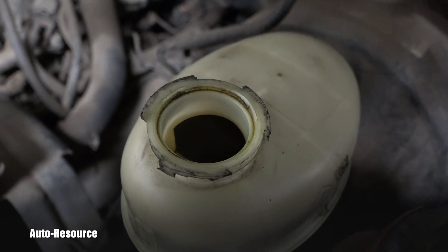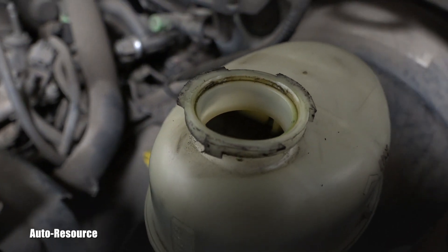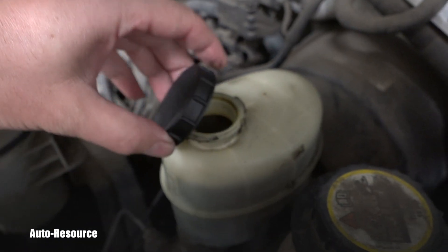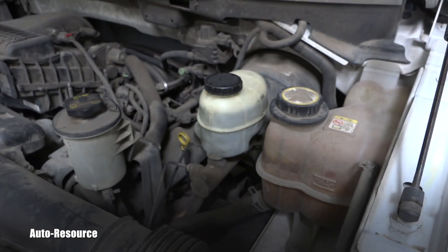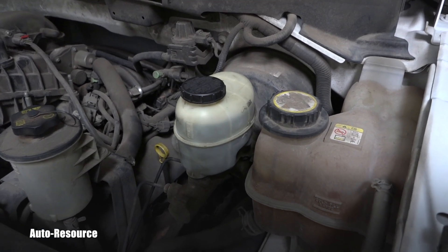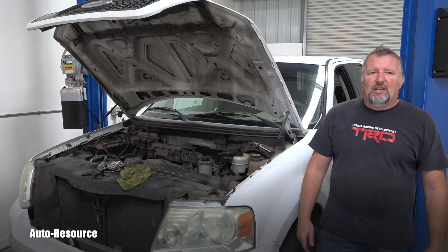It's almost black. When it's getting old it turns dark green and then kind of blackish — you see how bad it is. This should be flushed ASAP. If I bought this truck today, that would be one of my first priorities: replace that brake fluid with new. Now you know how to inspect your brake fluid on a 2005 Ford F-150.